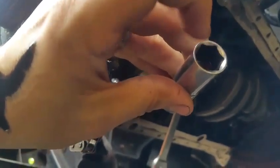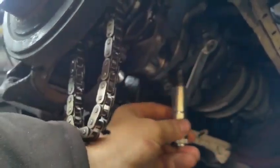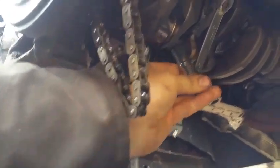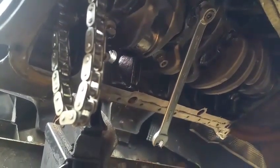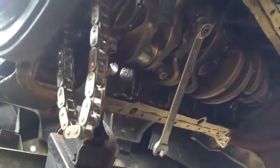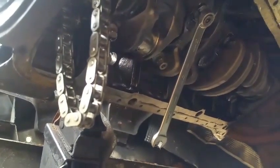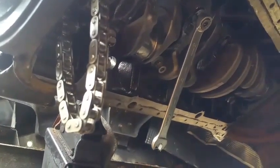And what I mean by a deep socket, I mean this is a deep socket. I just want the actual piece that attaches to be long, because the center portion is just obviously too narrow. If I try to install it, it looks like it goes all the way, but it's not. It just goes loose. So it's a little tricky. It seems like a number 14 would fit. And yeah, if you take a number 14 socket and put it right over it, it actually will fit, but you're gonna end up stripping it. So you'll need a number 13 that's kind of long.